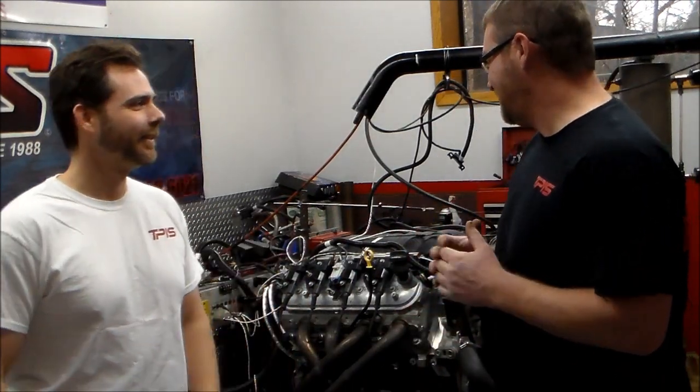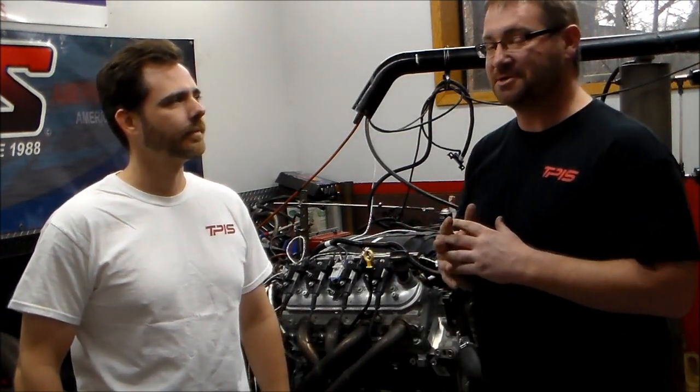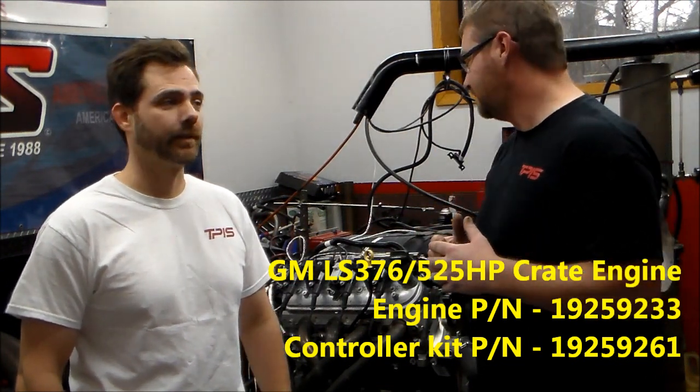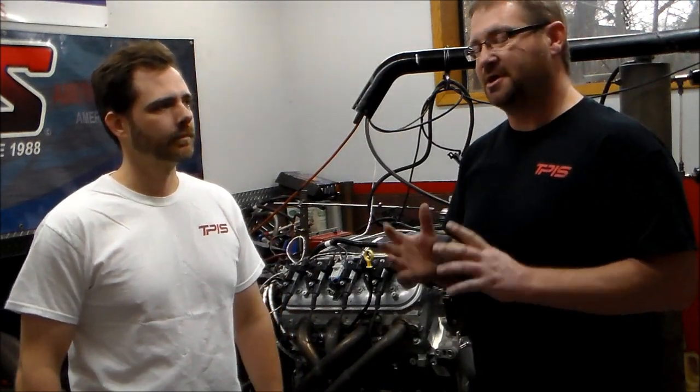So we fired up the motor and gave it a couple of pulls. Jim, how do you think it went? It went just fine. A lot of times when you buy a crate motor that comes with a computer, sometimes things need a little bit of tweaking. Generally it fired right up, which is what an EFI motor is supposed to do — that's one of the nice things about fuel injection. It's a little bit rich in a few areas, but we're going to put it in the car, so when we get it in the car we'll bring it back and put it on the chassis dyno, because the exhaust will be different and it'll have an air filter, and things like that can change some things.